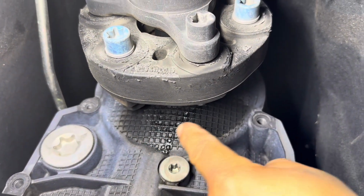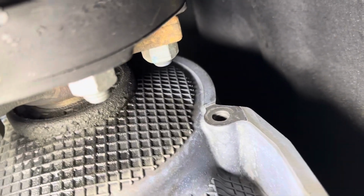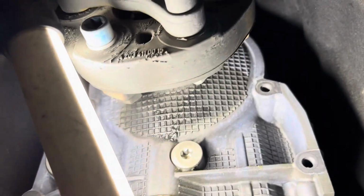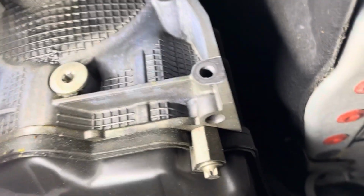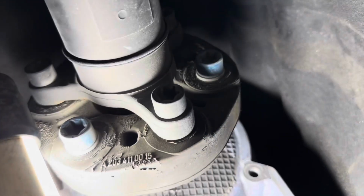All right, buddy, as you can see, you have a rear main seal leak as well right here. We did not discuss anything about that, but as always, this is the time to do it because I would have to take all this off again, okay? So that's nothing to do with that leak over there. See, it's coming right here. It doesn't cross that, so it is leaking. I know you need your car, so I'm gonna continue with what we agreed on, and we go from there.